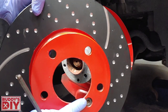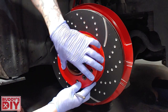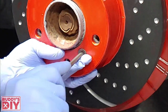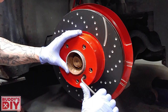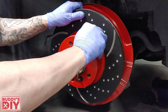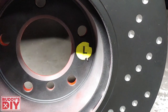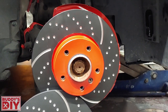The easy trick for installing the rotor is to have your bolt in place, place the rotor on, and line it up with the screw hole in the hub. Take your Allen key, flip it around, and screw it in — then tighten it down nice and tight. And before anyone says I put these on the wrong way — here's the other one with a factory sticker that says 'left.' This is the right wheel, so everything is correct.